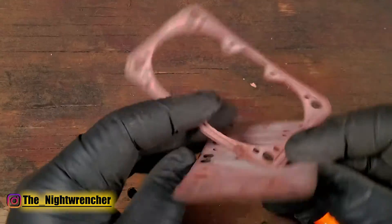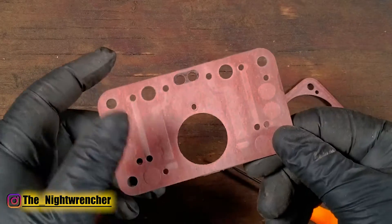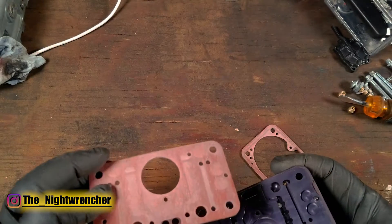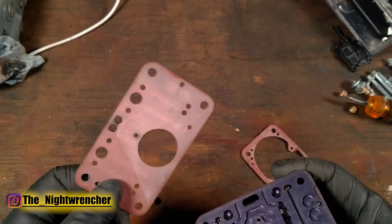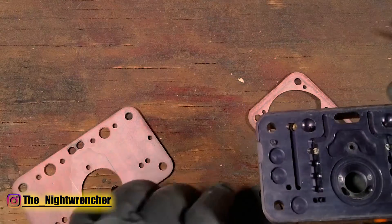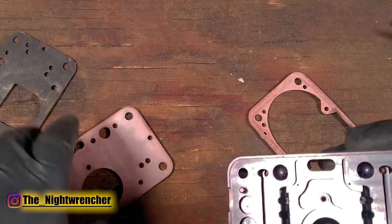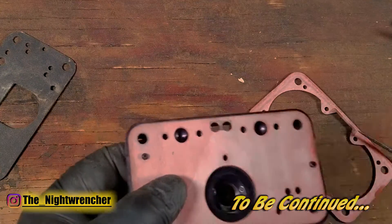These gaskets come in different colors: black, red, blue, and pink. The pink ones are actually a higher-flowing version of the standard gaskets. I'm not sure if Proform is the only manufacturer, but these particular ones have been on and off this carburetor about 20 times and haven't stuck or ripped. One set will probably last you the life of the carburetor. Another difference between the Proform gasket and a standard gasket is that the standard gasket leaves some areas exposed on the metering block, while the Proform gasket is cut out in a circle and leaves just enough room for the power valve and not much else.